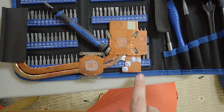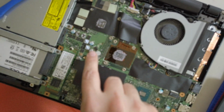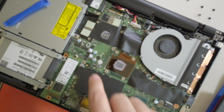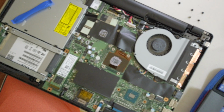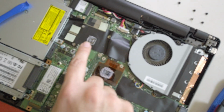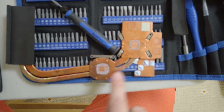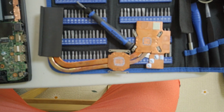Now on this one, there's these four little splotches here which coincide to these four, I'm guessing, either power regulators or capacitors there. So I don't think I can put liquid metal on those, so I'll have to go grab a tube of my regular Cryonaut. But that and that are going to get the Conductonaut, and those patches ought to leave me a good square to use for an outline. So, back to the time lapse.